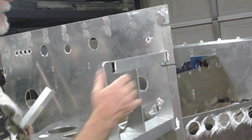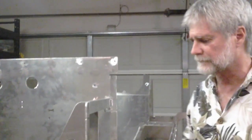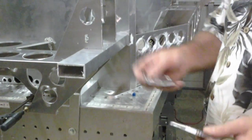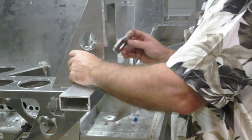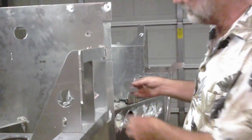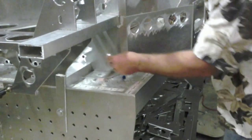Three quarter by inch and a half secondary frame rails. These are our plates - that is on every end of every A-arm. See the slot here and the thickness here - one rivet goes through all of them and catches it. Those are going to go right here for the upper A-arm front mount. Same thing happens back here for the lower mount, the lower A-arm. Same thing happens here and here.